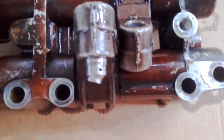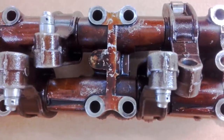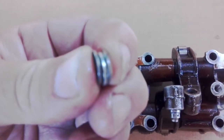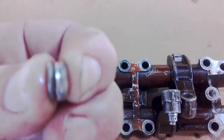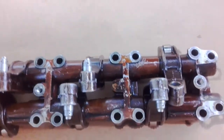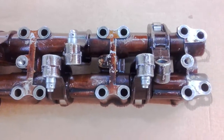This is with one shim installed and this is with multiple — have a look at the difference. Basically what we're looking at is a pack like that when I pack them up for a reground cam, because you lose a lot of material off the base circle — about 180 thou. That's quite staggering. Two shims and a hard washer in the middle. Ideally it's best to use the valve lash shims I showed you, but I'm still doing trial work on this to find the best outcome.